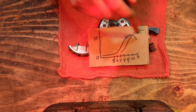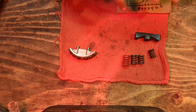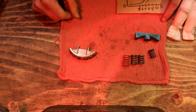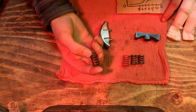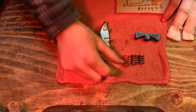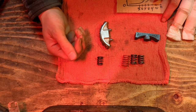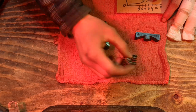Those are your three things that I would focus on to make your clutch work, to put that power down so that you're making power when they get on that bike, when they get on the throttle. In my opinion, doing clutch modification makes the older KTM 50 platform a totally viable and very cheap platform. They have a very bad reputation because of this clutch shoe and either the super weak mini adventure spring or the real pain in the butt washer stacks. You can get a very cheap bike that is not necessarily just as good. There's still a lot of benefit in those newer water cooled bikes, but you can get a really darn good bike for really cheap, and it really doesn't cost a lot to make these things work.